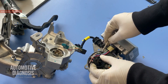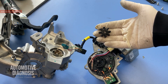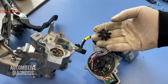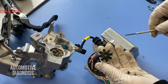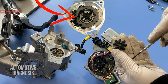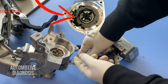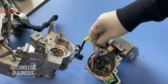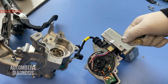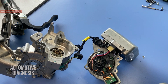One of the very common problems is here on this coupling. This is the EPS motor — the coupling sits right here and rotates the other gear. This coupling is actually one of the most common problems on EPS assemblies. Many manufacturers have TSBs for replacing it. Sometimes you hear a clunking noise from the steering wheel, and when you remove the EPS motor you find this coupling is completely ground down, just like the photo on screen. When it's damaged, there's nothing left, creating free play and causing that noise.